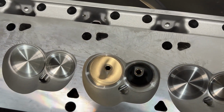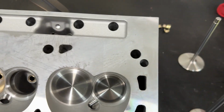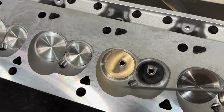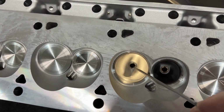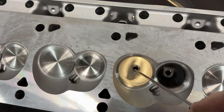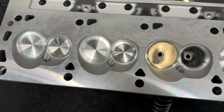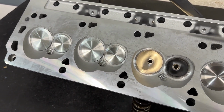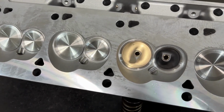So because of that, since they have all their valve train parts that they put in there to keep things more universal, the only thing that's different from these heads that you might get from AFR versus ones you would get from some other company that look exactly alike is AFR actually has, when they're manufactured over in China, them install guides for an 8 millimeter valve. That is unique to them, for sure. Because every other one you see that looks like this might be exactly looking like this. The valve job might even be very similar. It will have 11/32 stems, not 8 millimeter.